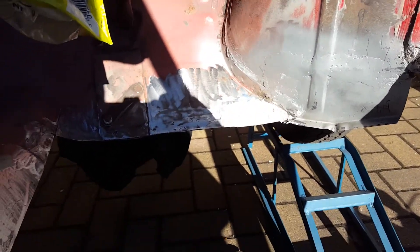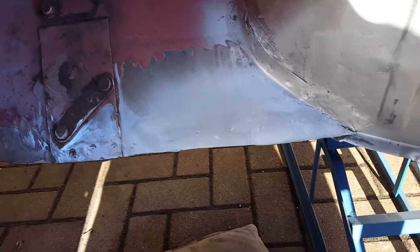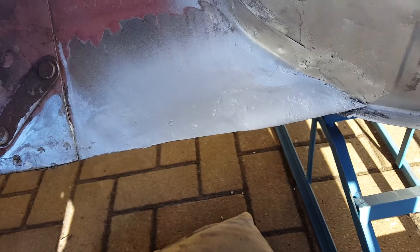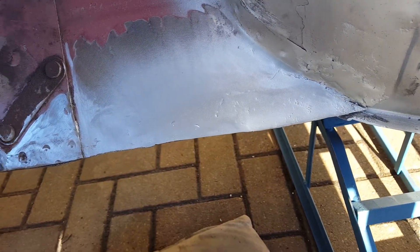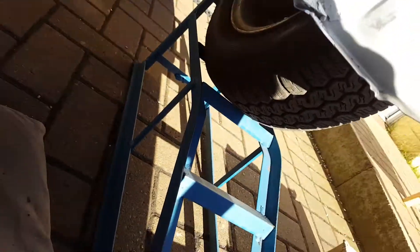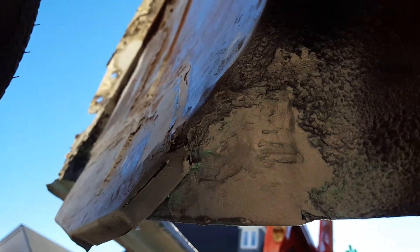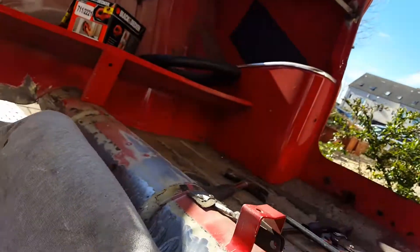I'll come back and show you once it's been sanded and primed with etch primer. So as we can see, this is the final part here. If it had been going to be on show, I would have sanded it so you can't tell the difference — it's a wee bit bumpy, but for what it's to be, it's nice. Underneath I've got weld penetration as well, and I've primed it to stop any rust getting in. There's quite a lot of stone chip under here that I'm going to need to get all the way back — that's going to be a fun challenge. I'm happy with that.